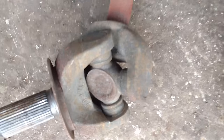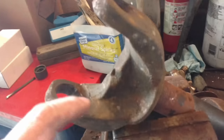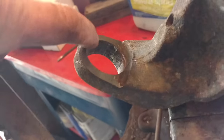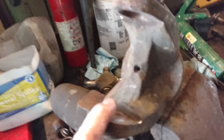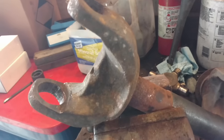Now we've got to get the axle joint out. It actually feels really good, but I'm not gonna go this far and not do it — I went ahead and ordered new ones. When getting ready to go back together on the axle joints, I take a flat file and go across the surfaces where the inside clips seat, just real lightly to get the rust off and make sure it's flat. I do it on all the surfaces where the clips go so when I put it back together it's sitting in there flat and I don't have to fight the U-joint going in. U-joints are nothing new, so I'll get this one back in and then get on the ball joints.